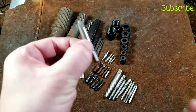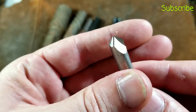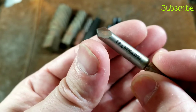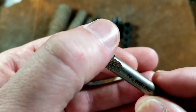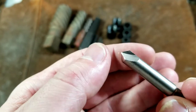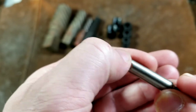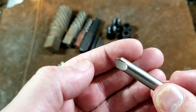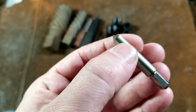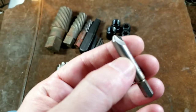Then we have some very common-style Phillips head screw extractors. Most of them don't work because they're not made well enough. Now these are some Craftsman's, and they're pretty nice because they have a very sharp drill point — they're actually a drill bit with just the tip, and it drills out until eventually it grabs hard enough to extract the Phillips head screw. These tend to work better especially when they're sharp, because you can tap on the back a little bit and that will usually grab the Phillips head enough to allow you to extract it.